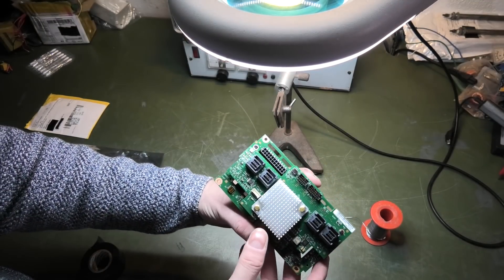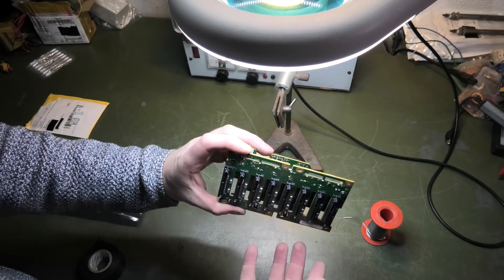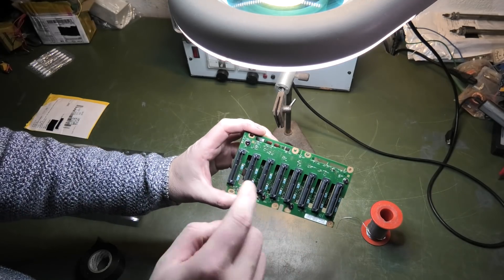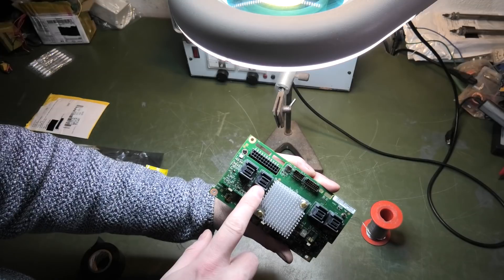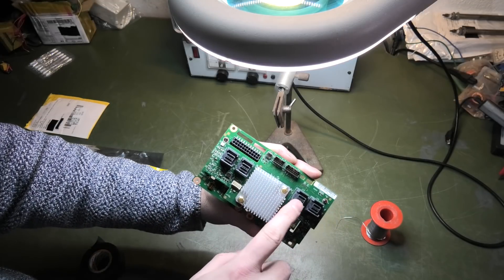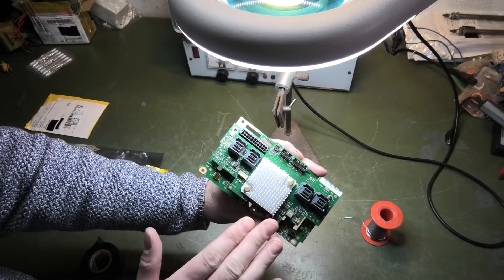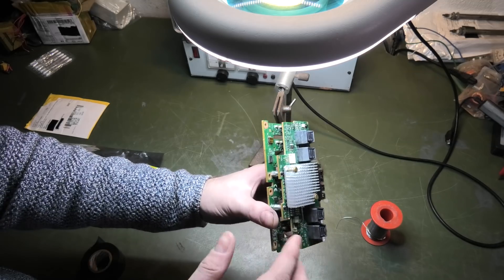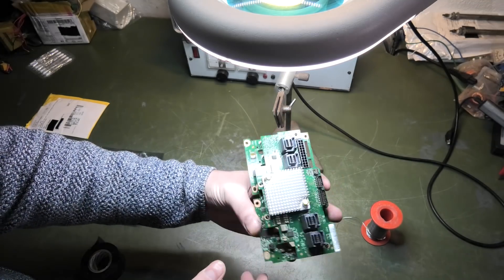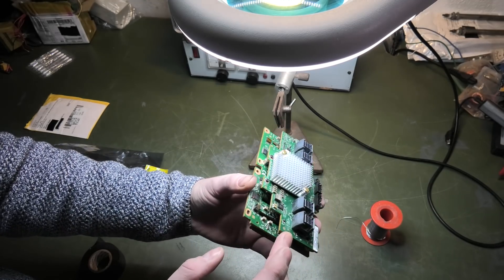Here it is — it's a PCB, and it's a rather good one. It can handle eight hard drives on one side; you put that in the front of the server and pop in eight more hard drives. On the back you put in two SAS connectors — 12 gigabit SAS connectors — and it expands to the next backplane. The top of it has the expander; the bottom is more or less a regular one.